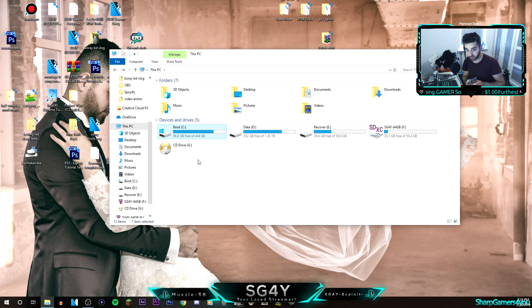Let's say your console is bricked. Remember in my tutorial on how to install a CFW — how to actually jailbreak your console — I told you to make a backup of your flash patch or your original flash. If your console is bricked, you use this cable method to transfer files, and you just put that flash backup back into the HDD and it should be unbricked. But that's the worst case scenario. Usually, if you just rebuild the database or reinstall the update, it should be good.